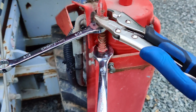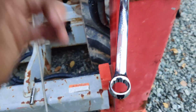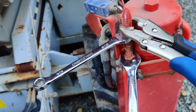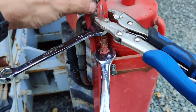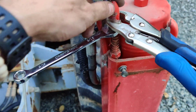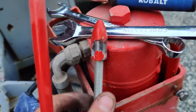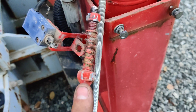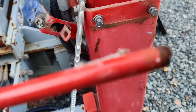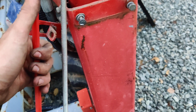Here's some bonus footage: the plastic piece that goes on the bottom and hits the limit switch rod broke — you can see it over there. We're going to try to fix this with some all-thread and make a new one, because it's just a rod that goes down with a nut on the end. The limit switch rolls up and pushes the switch in, so we've got to get this cone off, then there's a nut that holds it tight and a nut welded there. Here's the all-thread — the cone fits on it, same thread. I think if he gets two nuts and puts them down here and tightens them at the same spot, then cuts it to length, we'll be good.